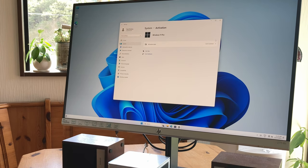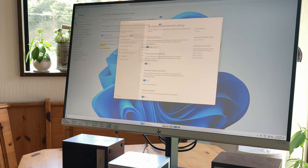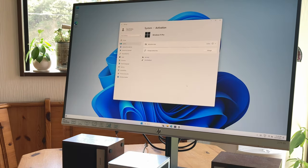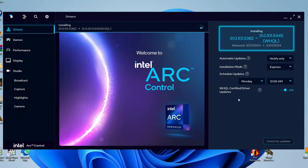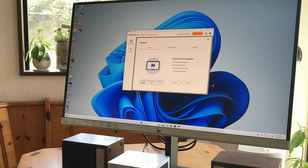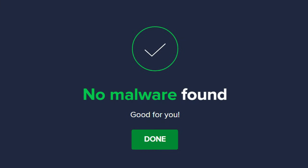To activate Windows we need to go online. Before doing that, we check for tampering — both Edge and Defender settings check out. We connect to our WiFi and Windows activates automatically online. We can fully update Windows as well as Intel driver updates without any issue. We then went to Ninite.com to download some free tools, which is definitely recommended for a new computer, followed by full system scans of both Malwarebytes and Avast, which tell us the system is clean of any viruses.